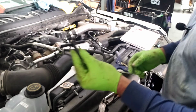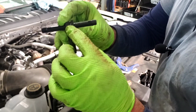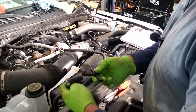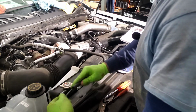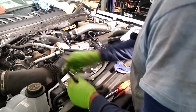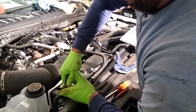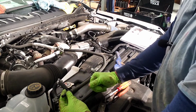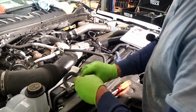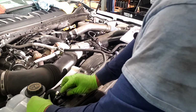The orifice that you removed, you're going to connect it where it says. So at the bottom here it says radiator. Put that towards your radiator hose. And the side says engine. That goes off the engine hose here. Be careful not to break these. You cannot buy these individually. You have to buy all the hoses together, which is about $120 from the Ford place, maybe $130. I can't remember what I paid for it last time. They do get fragile with age, so just keep that in mind if you're putting it on a truck that's got some miles on it.